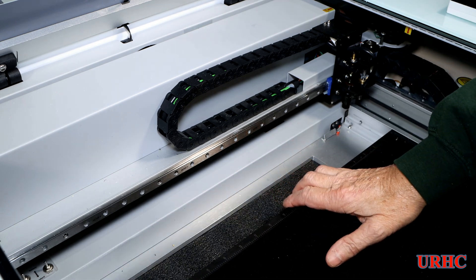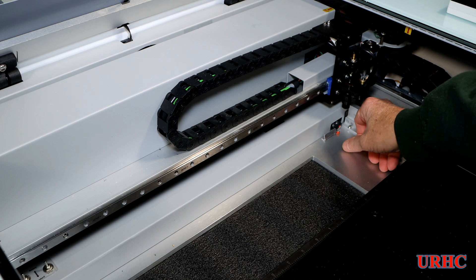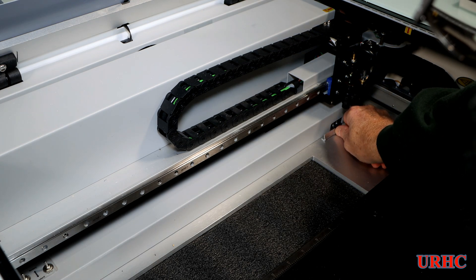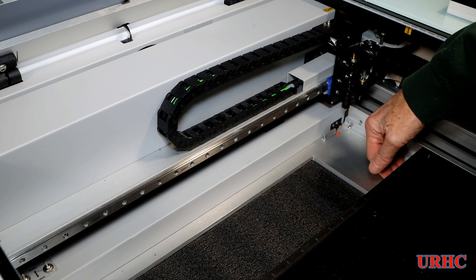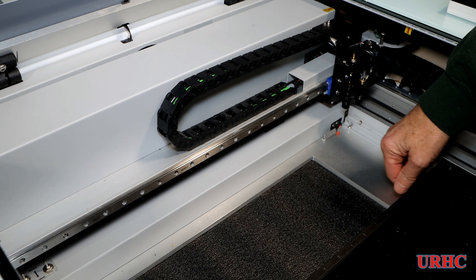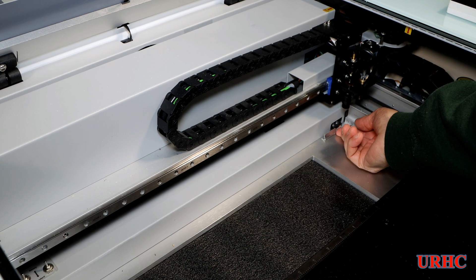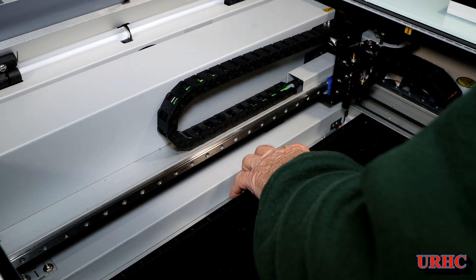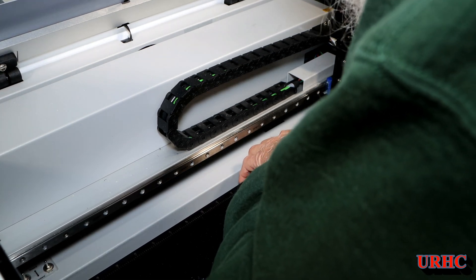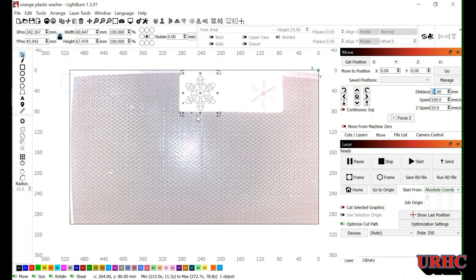Here's the problem I had: when you pull the drawer out, there's a little switch down there. There's a little aluminum bracket that's angled up — it pushes the drawer up over the switch when you push it in all the way. What I had to do is bend that little lever on the switch up a little bit to make it so the switch would click. Every time you push that drawer in, listen for the click on the switch, otherwise you'll get that error message.